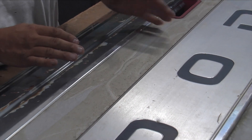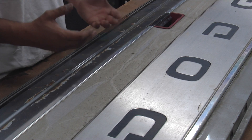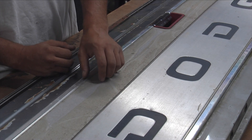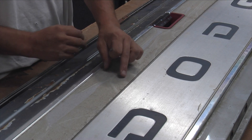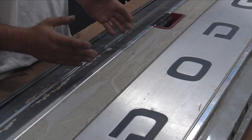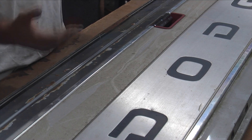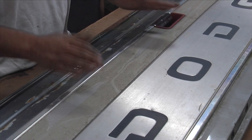On the tailgate, this is the original surface of where the red stripe was attached. Most times what happens is as these stripes age, the vinyl tends to change — it's a specialty type of vinyl but it does still shrink and lose adhesion on top of the stainless panel. You'll either have the red stripe peel off, in some cases leaving residue, and in most cases water has gotten behind it over the years leaving this textured surface. Because it is a semi-transparent stripe, if you don't clean it up you will see through the stripe and it's not going to look good. The brushed aluminum or brushed stainless texture is what we need to recreate here.